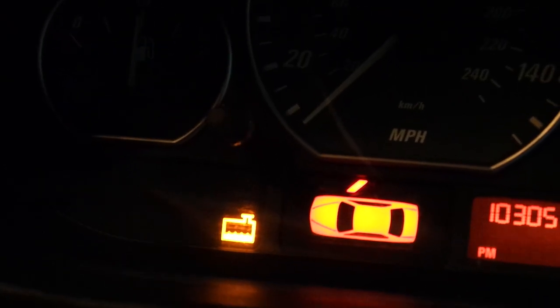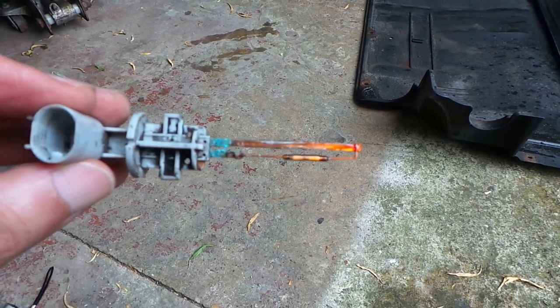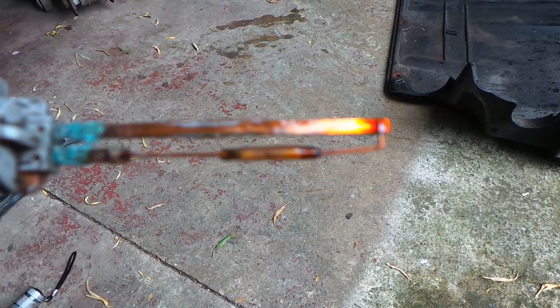Let's go ahead and remove the sensor itself. I'm going to grab hold of that white level sensor and rotate it clockwise by 90 degrees — yes, clockwise. It's a bit counterintuitive to rotate it clockwise to undo it. I'll need to put the camera down to do that. Here is the sensor itself — you can see it contains what looks like a magnetic reed switch.